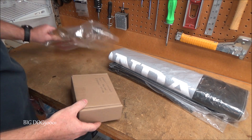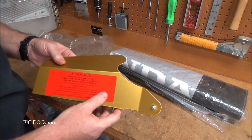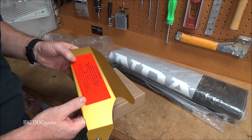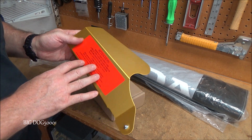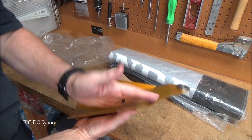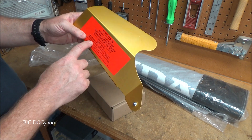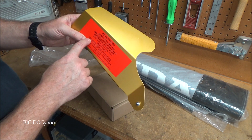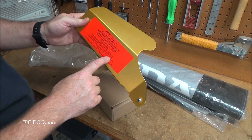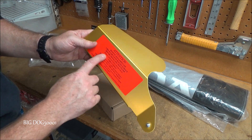How about some more Honda specialty tools? In this case, we got a couple of oil deflectors. If you've watched my videos, you've seen I have a blue one that works for older Accords. But I had a newer Pilot in the other day, and when I did the oil change it made an absolute mess — that's where these deflectors come in. You put them under there, and when you take the oil filter off, the oil hits this and drains into your drain pan instead of getting all over the place. This one says 2001 and newer Acura MDX, '99 and newer Odysseys, 2003 and newer Pilots, 2006 and newer Ridgelines — anywhere from the early 2000s to around 2012-2013.